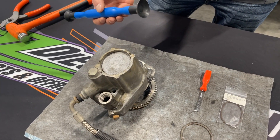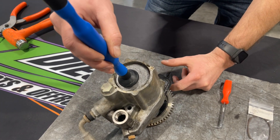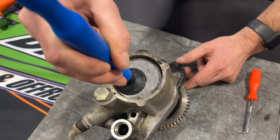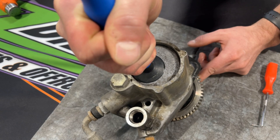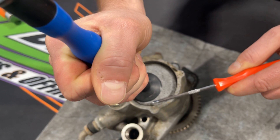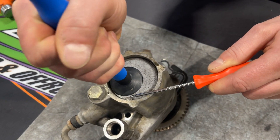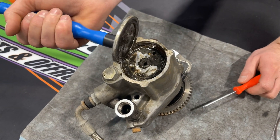Take a little bit of spit and lick your finger, wipe it on your actual suction cup end. Put your suction cup end on here. What we've found that works the best on these things is don't center the suction cup — actually go offset to one side a little bit. Make sure you press all the way down on that thing, and then you're going to use your pick to get under the corner, kind of over by your offset suctioned area, and pick at that thing at the same time as walking it out. You've got to be very careful — don't get crazy about it, and the thing will come right out for you.